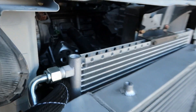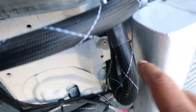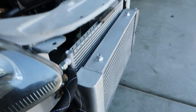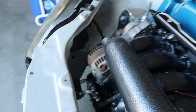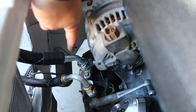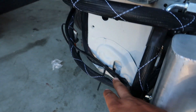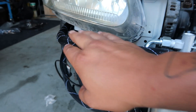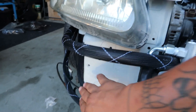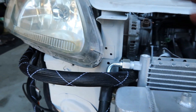The canister itself on the DC5 Creations kit is actually integrated with the condenser. Both lines run from here downward to their locations. The condenser mounts right here — I call the smaller one the 'skinny boy' on the bottom and the larger one the 'big boy' that goes in here. Both lines are mounted. This line here is the one I said is kinked over — I felt like it should have been shorter for an easier transition. I think the big boy line should have had a U-shaped set so the hose slopes downward, allowing both hoses going to the condenser and the compressor to be closer together for better fitment and tucking. That's where the bumper interference is happening.